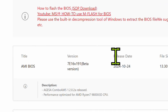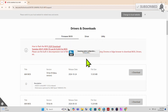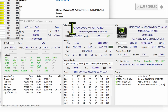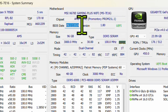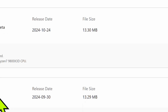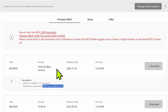So all of those fixes and features — but how do I know what BIOS I'm on? For that we'll open up HWinfo, and I'll have a link down below where you can find it, and I'll click Start. Now here is your motherboard right at the very front, and we can see the model number and everything I selected. The BIOS date is 9/27/24 and it's version 1.80. So if we come back over here, the latest is 1.8 dated 9/30. So I'm pretty current, but maybe I just bought this processor and I need it to work.